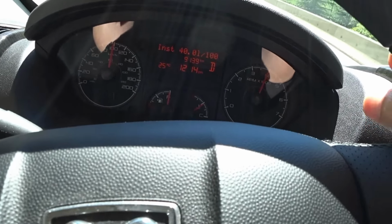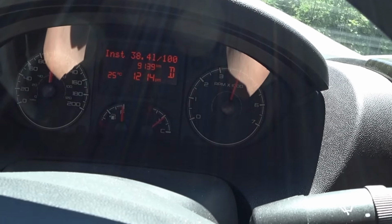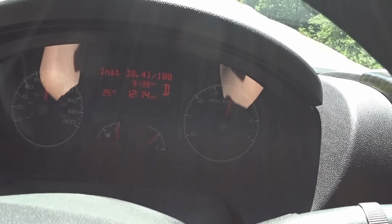One of the questions that we often get asked is, how is the truck on the hills? And it's actually pretty good. As I said, we've gone up steep hills, maybe 7% grade. You can stay at 100 kilometers an hour, that's about 60 miles per hour, and you'll be at about 4,000 RPM on the motor if you're going up that long hill. It is important you don't slow down, though. If you get behind, say, at Westphalia and slow down to 50 or 60 kilometers per hour, and you pull out to pass, it's going to be a long process.